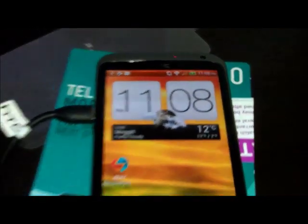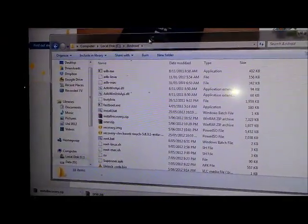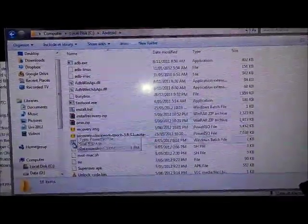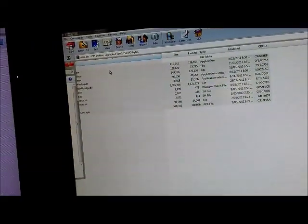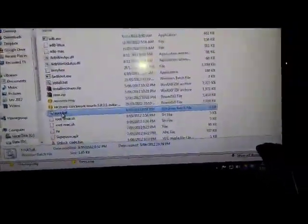Because at the moment you can't charge in recovery mode or the boot manager. So we go to that folder — in my case, C:\Android — and look for the file called root.bat, the batch file. In my C:\Android, just go to root.bat. Remember, this file came from the zip you extracted. Just double-click that one and the rooting should start.